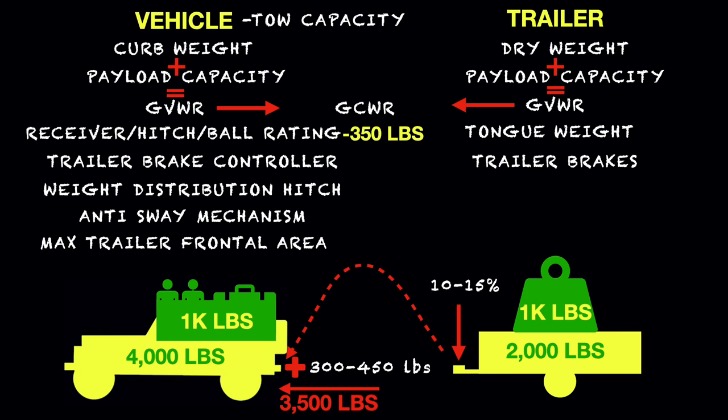That's most of the terms I can think of to share with you that I've learned about when considering towing with your Jeep. Just because somebody says they can tow something, it doesn't necessarily mean that they should. You don't want to go beyond the limits of your vehicle and end up with an expensive bill from a breakdown, or even worse, a catastrophic event. I've read online that some people recommend sticking to possibly 80% of your towing capacity — that way you've got a margin of error and you're not going to be stressing out your Jeep so much. If you're interested in knowing the gross vehicle weight of your Jeep and its payload, I'll put a few links in the description where you can look up the hard numbers and work out what kind of trailers will work with your rig.